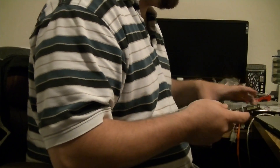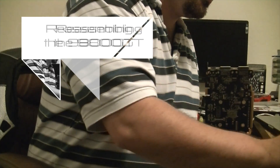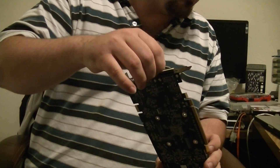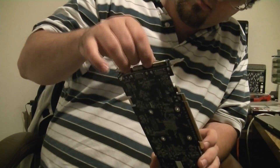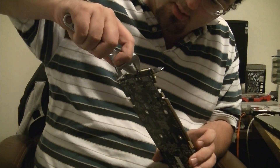All right, here's a card. I want to go ahead and get my two metal pieces set back up on here again and get these guys reconnected. I'm just starting these screws by hand — I like to start all my screws by hand to make absolutely certain I don't cross-thread them. I'm going to gently tighten these up a little bit more; you don't want to over-tighten these. You'll feel it when it stops wanting to move, and that's about as tight as you want to make it.